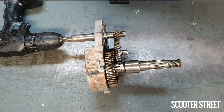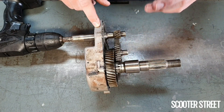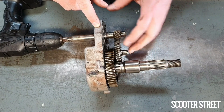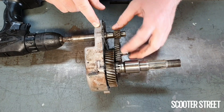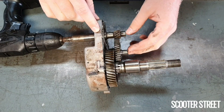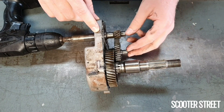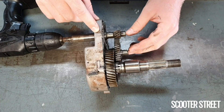This is why it's really important that you change your gear oil. Your gear oil is doing a lot of work and there's not a lot in there — it's the only thing preventing this from happening. Much like the engine oil in a four-stroke, very important to regularly change it. These gears wear as they're metal on metal. Particularly when scooters are brand new, before your first service, we usually do a first service at around 500 or 1,000 k's because these gears are bedding in — there will be tiny little bits of metal coming loose into the gear oil. We'll often see this when we change the gear oil at the first service, as the gear oil comes out almost looking like a metallic flake, like there's a slight metallic paint in the gear oil.